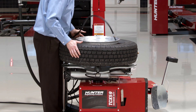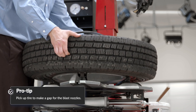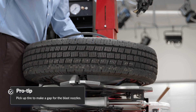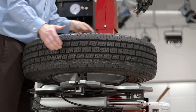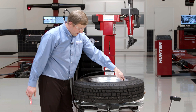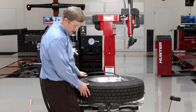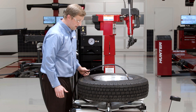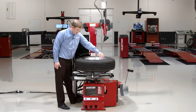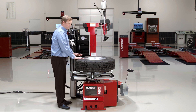So I'll hook my inflation chuck up and what I need to do is just make a gap for those lower blast nozzles by picking up on the tire. When I press down on the second stage of the blast on the inflation pedal, that's going to activate that jaw-based blast inflation. And I can see I have my bead taking air here. So I'll need to unclamp, just let the tire rest on the tabletop and continue to seat the beads. Bead seating needs to happen under 40 PSI — anything in excess of 40 PSI needs to have a safety cage. That's method one of blast inflation on this tire changer.